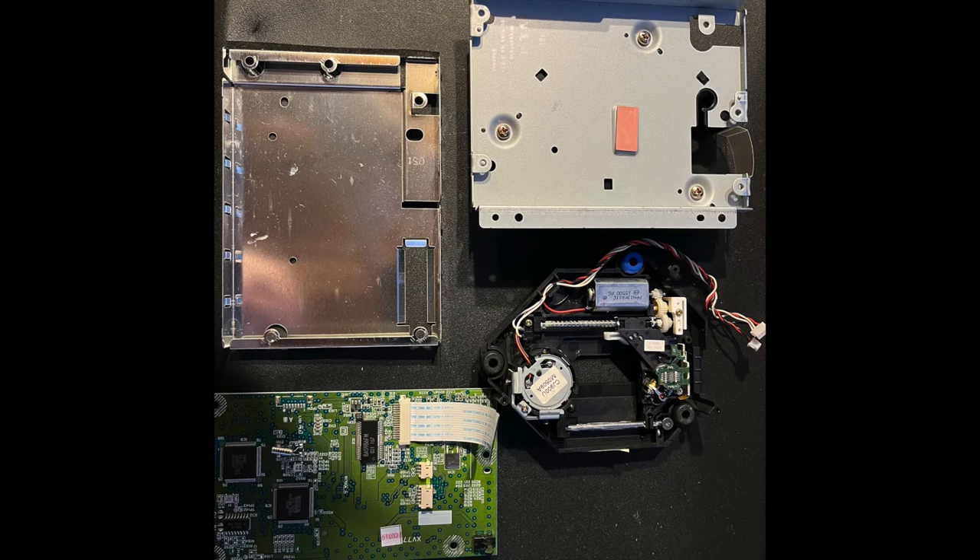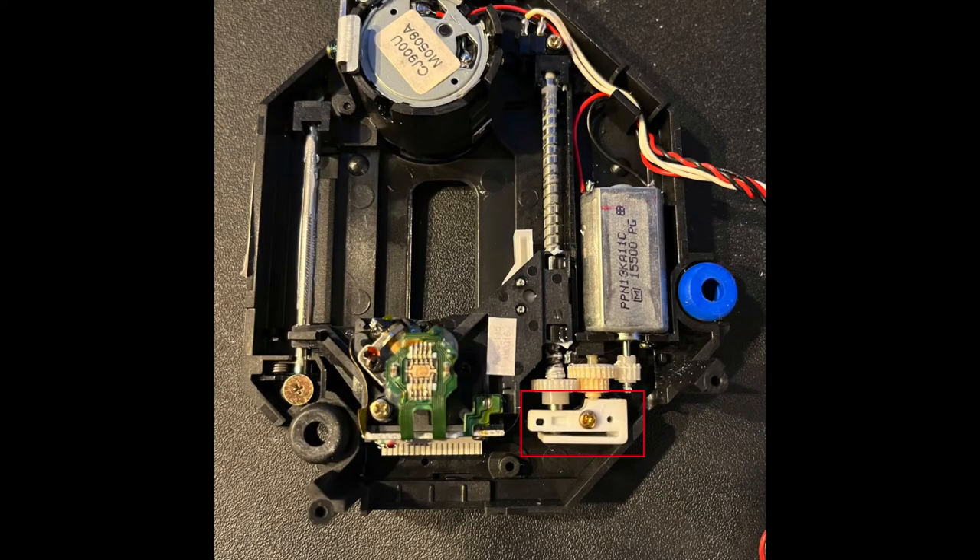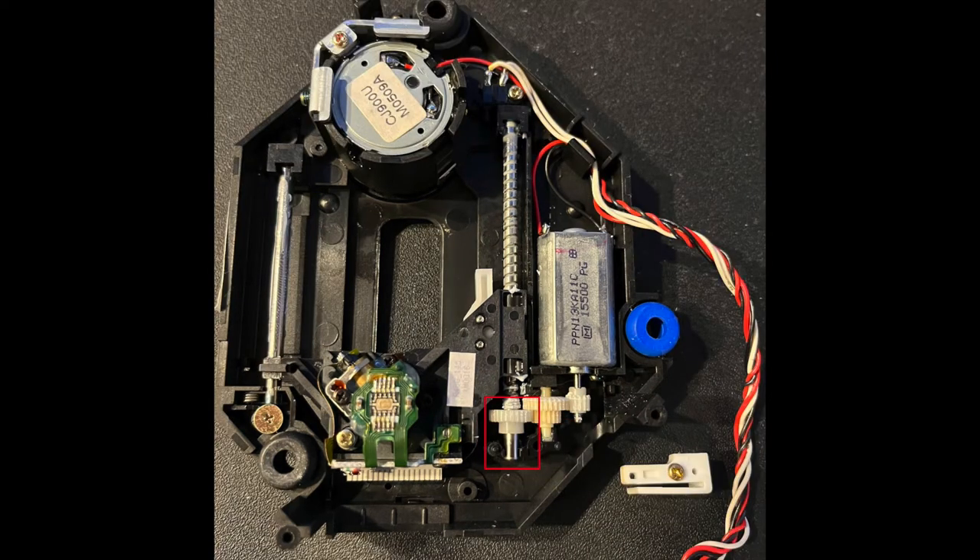Once all the pieces are separated, put the casing and the computer board aside — we're going to focus on the laser itself. On the bottom side of the GD-ROM enclosure, you'll see a little white plastic clamp holding all the gears in place. There's a tiny Phillips screw on top of this clamp — undo that and lift the clamp right out. With the clamp out of the way, you'll have easy access to all the gears and there's really nothing holding everything together. Grip the bottom of the swirled rail, grab the side that's in the little box, and you should be able to lift the whole rail and the laser out of the enclosure.